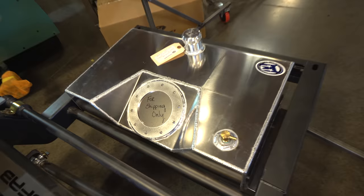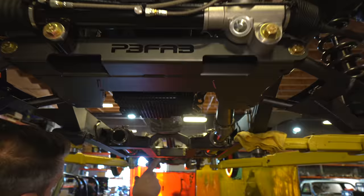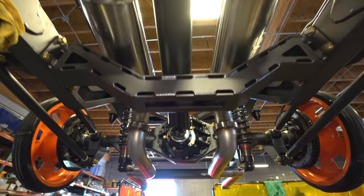This chassis over here — we're working on the exhaust system on it. Again, it's another three-inch exhaust. We've got some flex here — he's tacking it all in. Everything's V-band bolted together so you can get it apart. You've got the resonator, an X-pipe, and he's getting it all finished up. He'll probably be done with this today, if not tomorrow, then weld it all up.